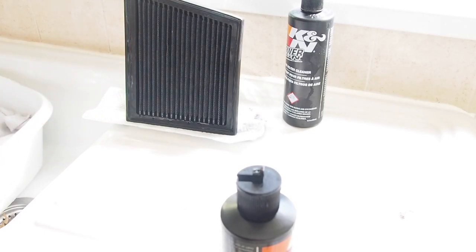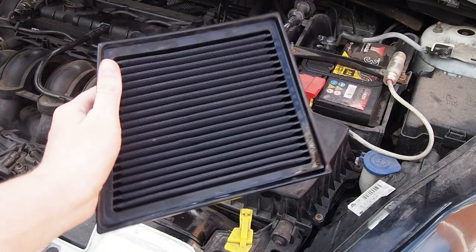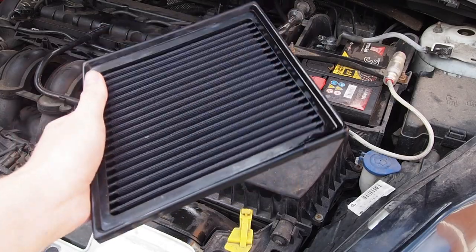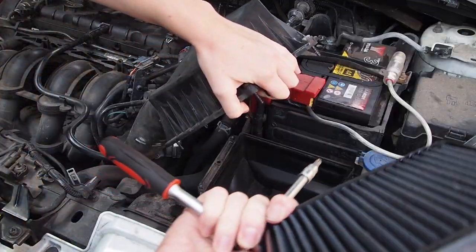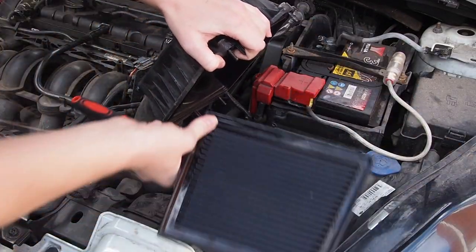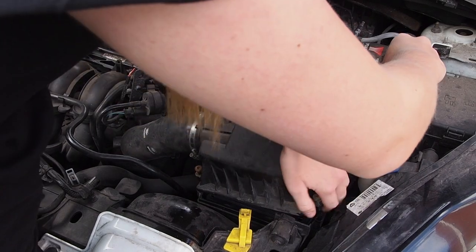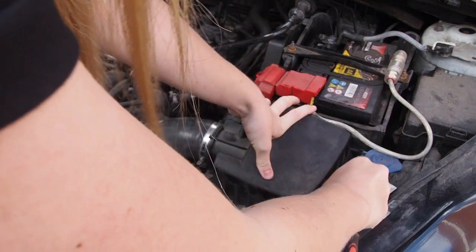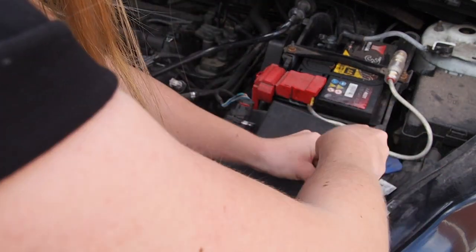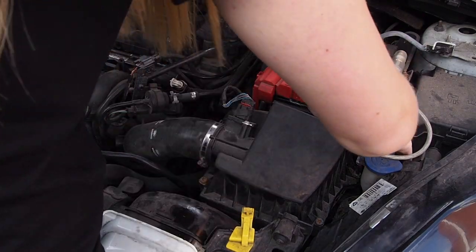Alright, I'm going to put that back over here on my tissue and let that soak in for about 20 minutes. Okay, so my air filter is now finished - I left the oil to soak in for about 20 to 30 minutes and I can now put it straight back into the filter housing. Make sure you put it the right way up - you've got the notches around the edge so you can't really do it wrong. Then all you have to do is do up the four nuts again. And that is everything.